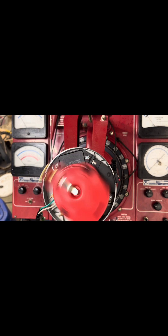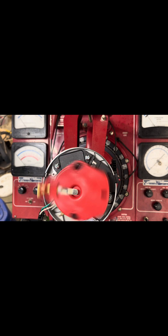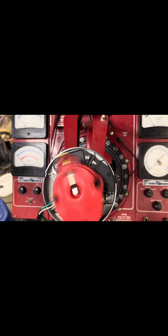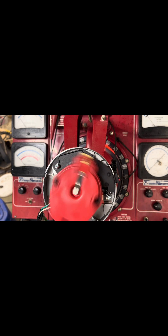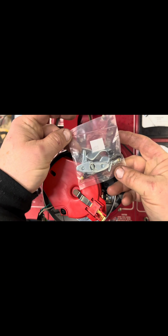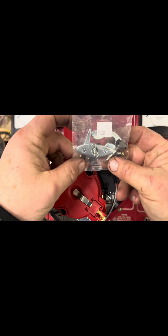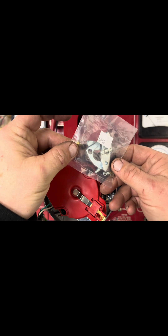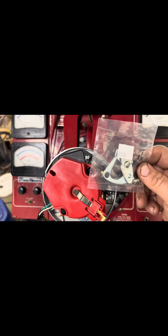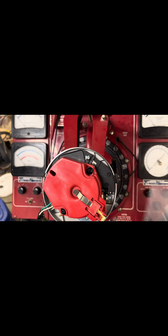So the curve looks pretty good — it just looks like it needs to be limited. It did come with a bag of tricks and no instructions. It looks like some of these might be a limiter, not for the vacuum advance but for the mechanical advance. So I'm going to put that in and see if we can limit the mechanical advance and have this thing work pretty much out of the box.